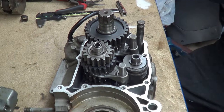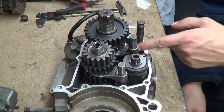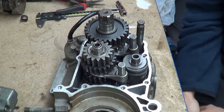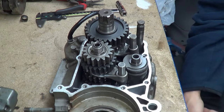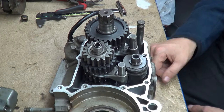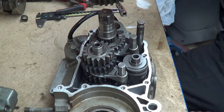What you can do is take loads of pictures and mark each part as you take it off. So this is the front selector fork, these are the two rear ones - you can write 'rear bottom' and 'rear top.' Mark the case with a white marker or chalk. What I'm going to do is take the gearbox apart and record it, so it's basically just doing a reverse of the assembly process. You can watch this a couple of times or use it as a review aid.